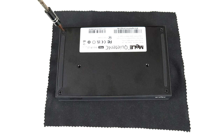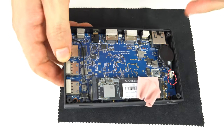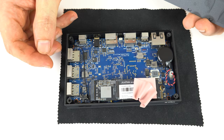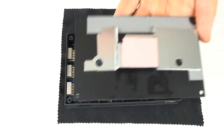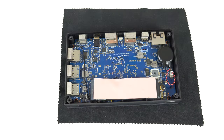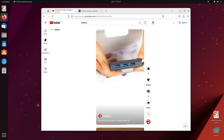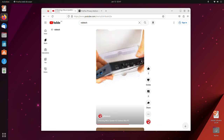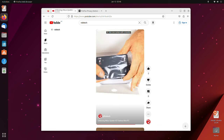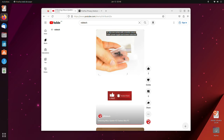The 4C is easier to open — just four screws and pop open the lid. Inside is the M.2 NVMe slot and the CMOS battery, and that's about it. All the other parts are soldered on, including the Intel AC 9560 WiFi plus Bluetooth module. As with every mini PC I've reviewed in the last year or two, Windows 11 Pro is included. Ubuntu works fine running off a USB drive on pretty much every N100 I've tested, and the Quieter 4C is no different.